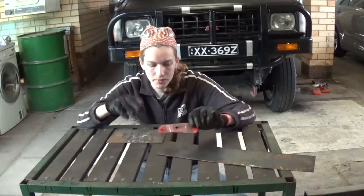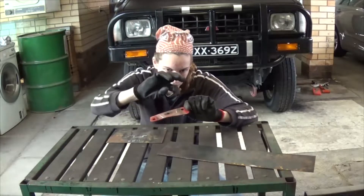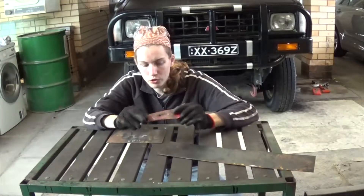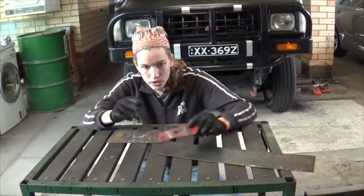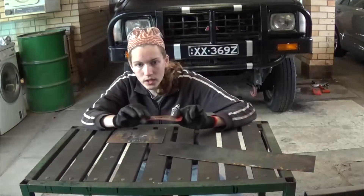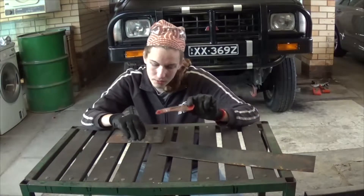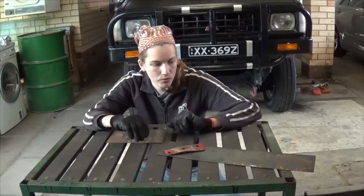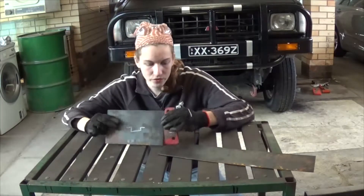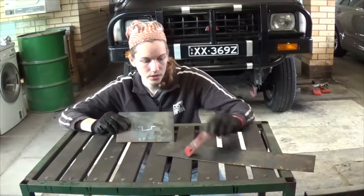So the idea is this is going to be raised up with a step between here and here - it's going to be folded once, folded twice, folded a third time and then folded a last time. It's going to be as similar to the original as possible and it's going to put it in a neutral position where the transmission is currently happy sitting. When the transmission is under load there isn't much problem - it's going to load this up. This isn't meant to stop it from idling nicely; this is meant to just smoothen it out when it's under load and make sure the trans doesn't go all cuckoo crazy. It's meant to give a little bit of play to be happy - it just sends vibrations otherwise and ruins your day.